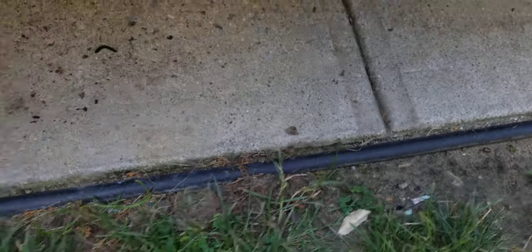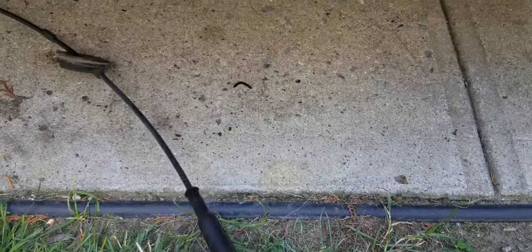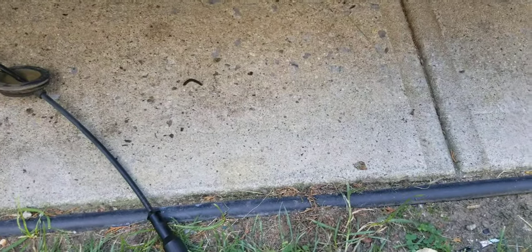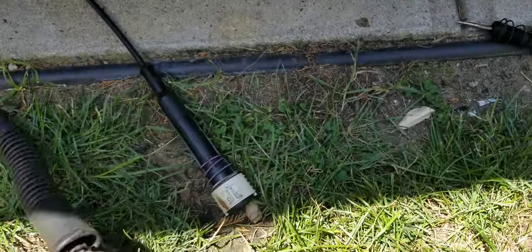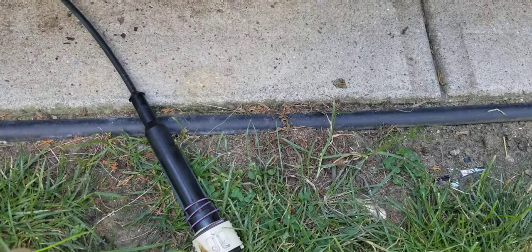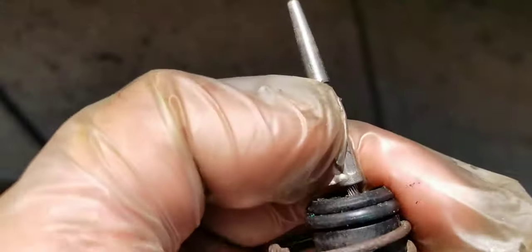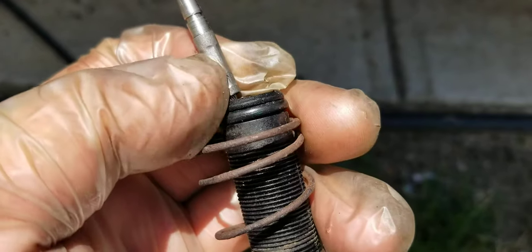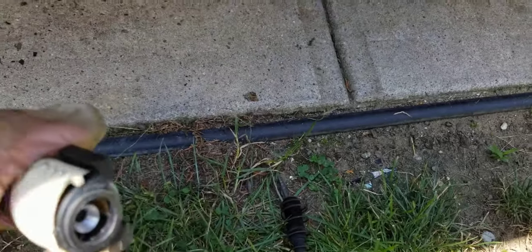I think I did it right the first time, but I didn't snap it in all the way, so the E-ring didn't catch. So I thought I made a mistake, went back, unhooked it from the connector, unlocked it, and tried putting it in again. It went all the way in — but the only problem was it was too far in. The E-ring, instead of catching here, caught all the way at the end. The farthest I could go was neutral because of how far it was in. I had to go out, get a new cable, put everything in place, then snap it in, and it caught at the right location. I think I know why GM does this — because they want to make money off of it. Once it becomes an issue, you're going to have to go buy a new cable.